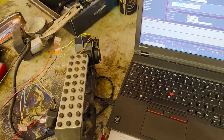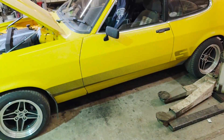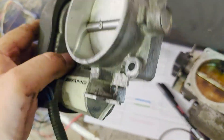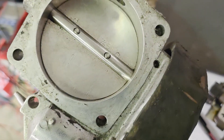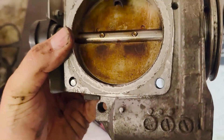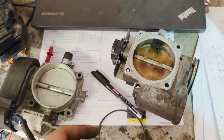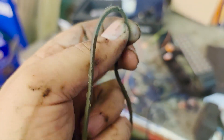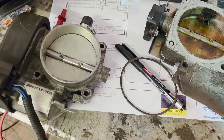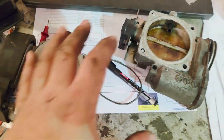Now I need to build a wiring loom for the throttle body and one for the pedal, then pull all the old ECU out and start working out what I can reuse. Here's the AMG throttle body prepped — should have bought a gasket for it. Here's the old cable throttle body which did the job but not anymore. I can't remember if it was just siliconed on but I don't have a new gasket, so I might have to RTV it for now and order a gasket.